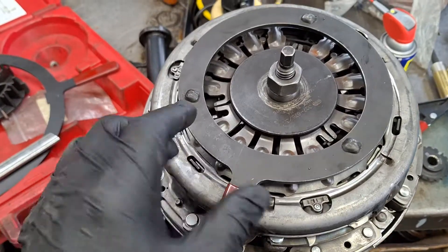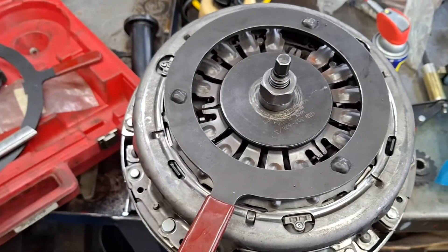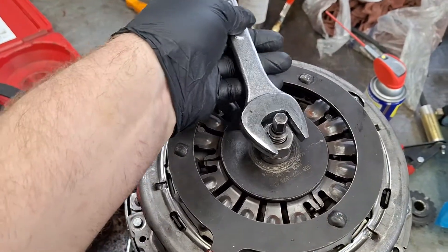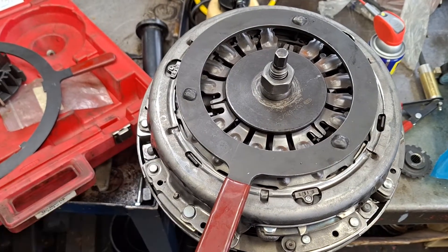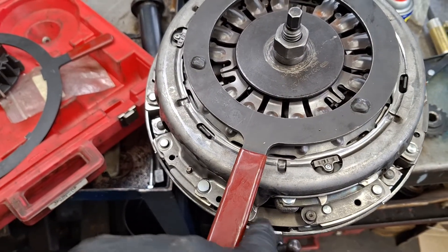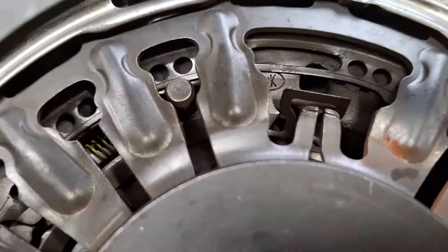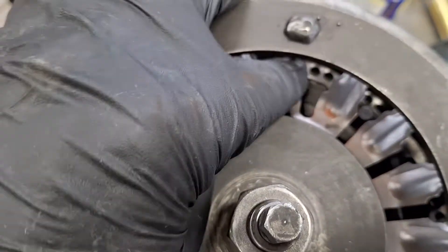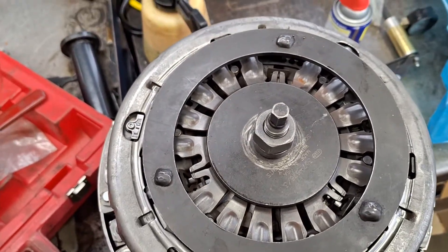You're going to want to turn clockwise to release the locks on the clutch, and then run this nut down flush. I have a cutoff wrench, one and one sixteenths, that I use to tighten the nut down clockwise. At the same time, you have to hold this clockwise. In order to turn this clockwise, it might be frozen, so you might need to tap this with a hammer — then it'll break loose. First, make sure the tool didn't fall down that other hole. Make sure it's still just touching this upper portion with the holes in it, not pushing on the case of the clutch itself.